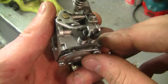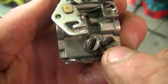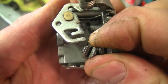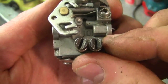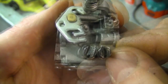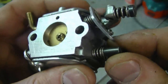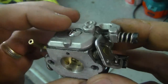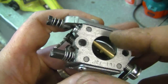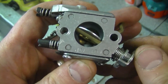Here's the carburetor again. The H screw is on this side and this is the L screw, the low screw. Just turn them out about a quarter turn each as a good starting point, then try your unit again. If it runs good, you know it's just a carb setting. If it still doesn't run, turn them out another quarter to half a turn. If it still doesn't run, replace the carburetor kit. When the engine only burns quick start or only runs on the choke, it's definitely a fuel issue — replacing the spark plug or anything else won't make a difference.